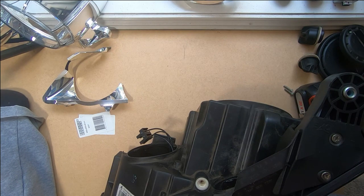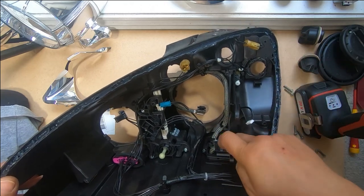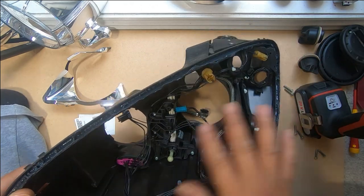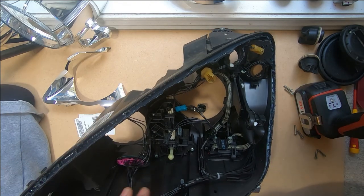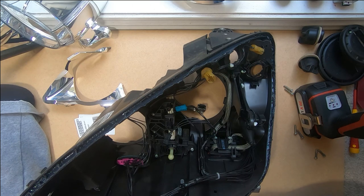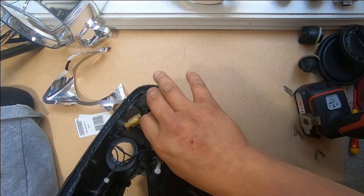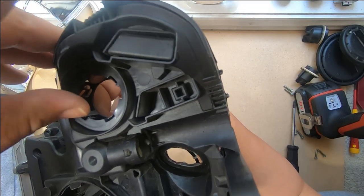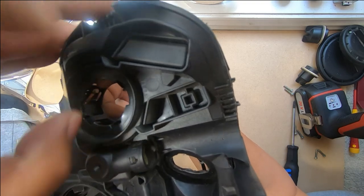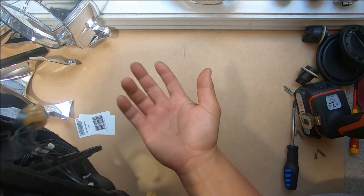Be careful with it — this is the time where you do not want to break anything. All we have left are the wires, the indicator, the ballast plug and the plug harness. Once we remove all this we can transfer everything over to the newer case. Let's take off the indicator — this is very simple, it is one piece. Do not try to pry it off. You're going to see three tabs here; pry on each of them and pull back a little bit and it slowly releases.